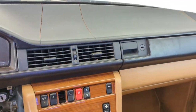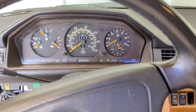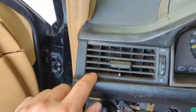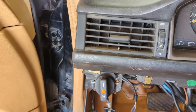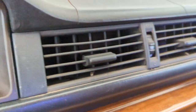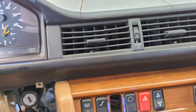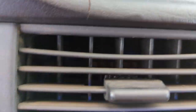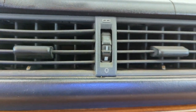Now I'm going to start taking things apart. One of the big things will be taking the glove box out and all the stuff out of it, taking the cluster out, unplugging everything, and starting to take the vents out. There are basically some clips — you can barely see them right here — you can use a pick tool and get those four clips loose. The center is a little similar. There's a screw on this side, screw on that side, and then basically there's an Allen fitting in here. I'll need a flashlight to really see it.